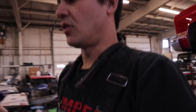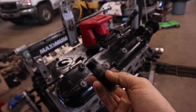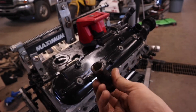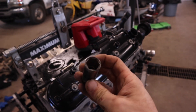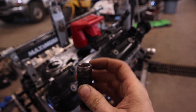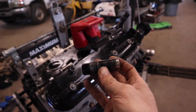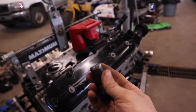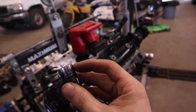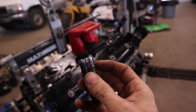So I started looking at the cylinder head and at the end of the sockets. I have a few sockets here - these are your generic Craftsman, Stanley, pretty much the same socket everyone's gonna have for doing spark plugs. They're fairly thin-walled on the end. But when I took a look at this one, which has done all my LS spark plugs, I started noticing there's a bunch of wear on the tip - just on about 3/16ths of an inch on the end of it. I'm like, well, why is it doing that?